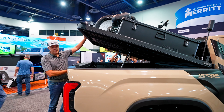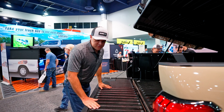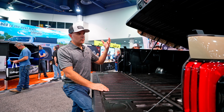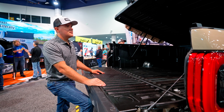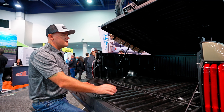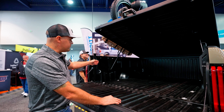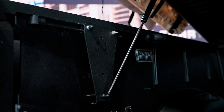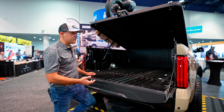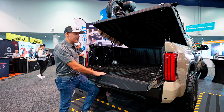The interesting thing about how we mount this is we don't use C-clamps. Most truck bed covers mount with a C-clamp on the underside of the bed. Since we're looking for a structural installation to ensure a safe payload, we have a chassis member that sits across the front of the truck bolted to OEM holes, and gas strut brackets that sit in the tracks and can be moved to the right spot. For trucks like the F-150 or Ford Ranger that don't have track systems, our brackets work with the holes they have.